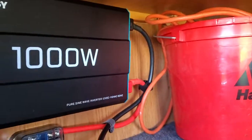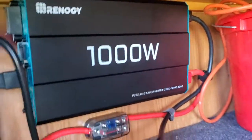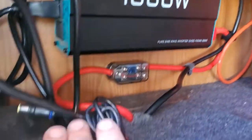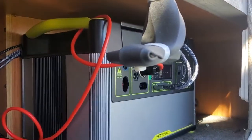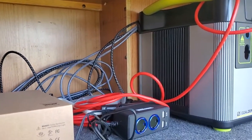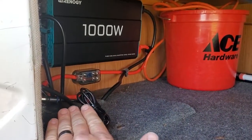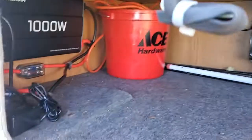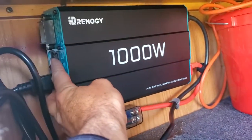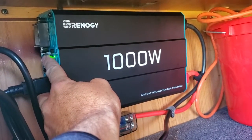The main thing is you always need to make sure that's off — if you don't turn it off, it will drain the main battery. Only charge the Yeti when the engine's on and driving. If you're idling, it's not the best. With this smaller one you should be fine while idling, but if you're going to be using the 600-watt power supply, you do want to be driving to give it a bit more power from the engine.